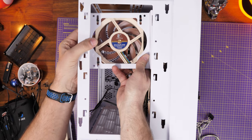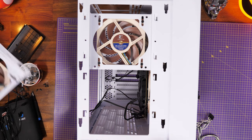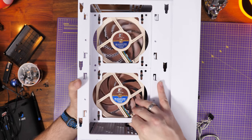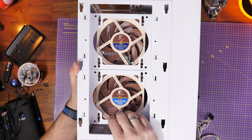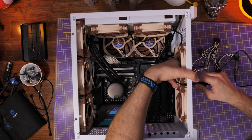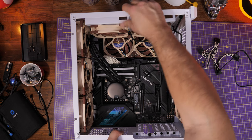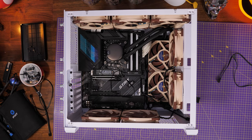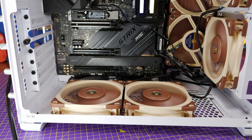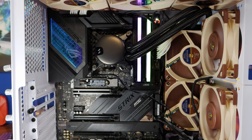Now I'm front mounting some fans and these are the wrong way around again. Usually with front mounted fans you want to install them so they pull cold air into the case and blow that across your GPU and your motherboard, then exhaust out of the top and rear. But I'm doing completely the wrong logic here — I've installed intake fans on the top and exhaust fans on the bottom and front, so it's pulling air in from the wrong directions and blowing it out in other ways.